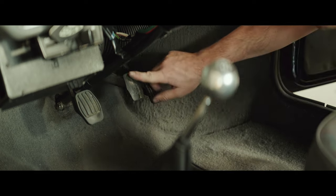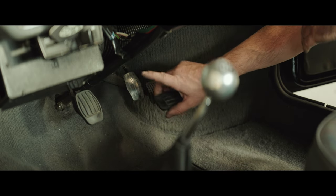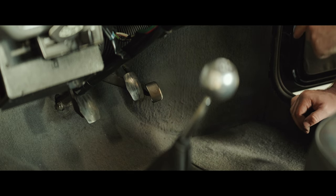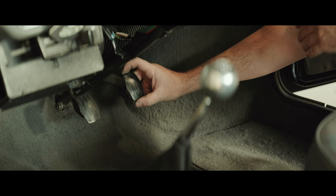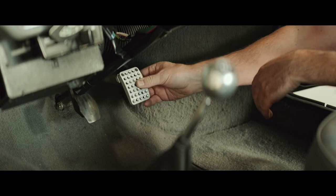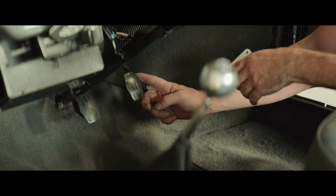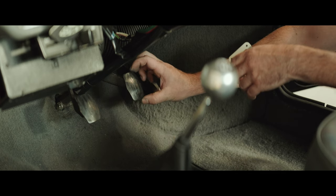On this car we're lucky and they're clean underneath — they haven't been glued. Sometimes people will put some glue on here, and if there is glue it's a good idea to clean it off. One thing we've noticed is that on later cars — this car here is an SPI, but on the MPI cars and some of the later SPI cars — although it's the same shape, it's actually a little bit bigger. You'll be able to tell when you mock up the pedal. If you've got one of the later MPI or later SPI cars, you may need to come in with a file or a flapper disc on a grinder and just take off the edge.